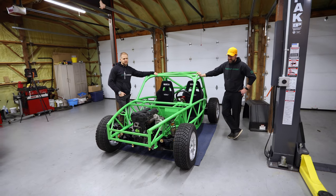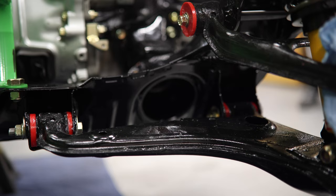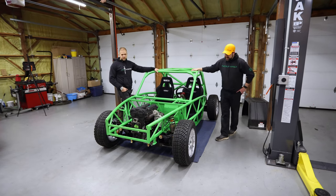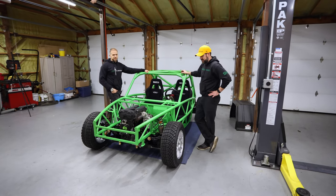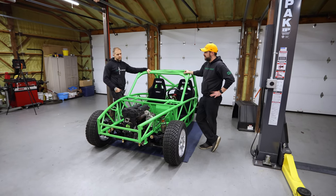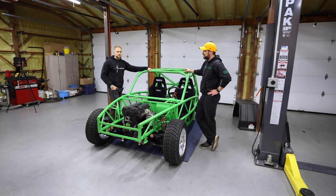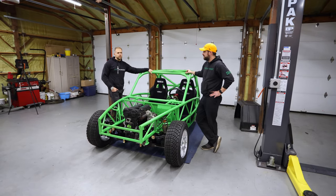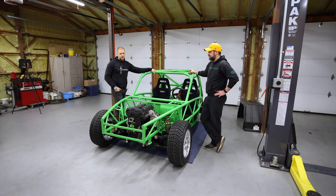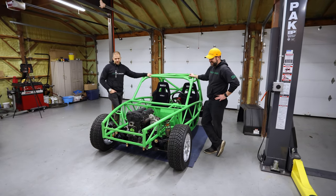It was super exciting. We kind of applied the supermoto philosophy to this - lightweight, long travel suspension, hopefully can hop some curbs and do knucklehead stuff on the street. All the bushings are now Energy Suspension poly. We didn't put the sway bars on yet, but we're gonna start with factory sway bars. We spoke with Paco Motorsports - it was Mark - and he recommended the stock sway bars to start because of the long travel. Having them a little softer would probably help - we want more sway to allow the travel to hit its full range of motion. It's gonna be kind of like a little mini trophy truck in a sense.